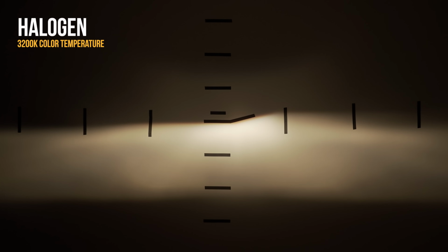In a projector, it was over 3 times brighter than a stock halogen bulb and fell only about 25% behind the Hikari. The funny thing about these two kits is the Hikari claimed 6,000 Kelvin and the TECHMAX claimed 6500, and they were kind of opposite as far as from our tests go. The Hikari was a little bit more blue, and the TECHMAX was a little bit more white.